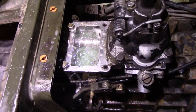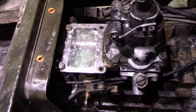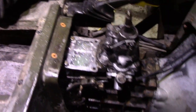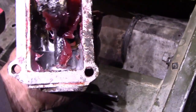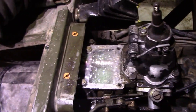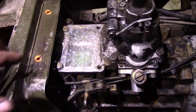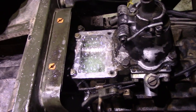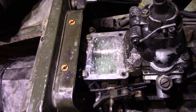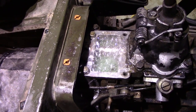I put two temporary bolts in here because it was blowing smoke through here. But to make it a bit more visible I've put some soapy water in the top of the gearbox just under the shifter, because that's where it was coming from - the smoke was coming out of a little cut in here. Well obviously there's nothing under there, there's not even a gasket on it. So is there an O-ring in here? Look at that - you can see the smoke coming out - the bubbles. Oh, that's interesting.